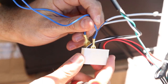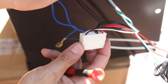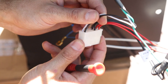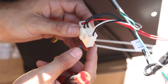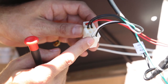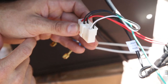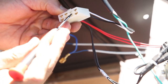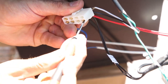Pull them out the back. Next, remove the main power cable — you've got a white and a black wire. These are the only two wires on the grill where polarity is important. The white wire goes on the side with the little clip, so when you reinstall these make sure the white wire goes on the same side as the clip. Remove those the same way by depressing the tab and sliding them out.